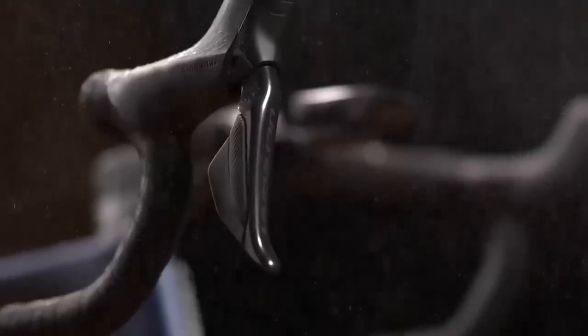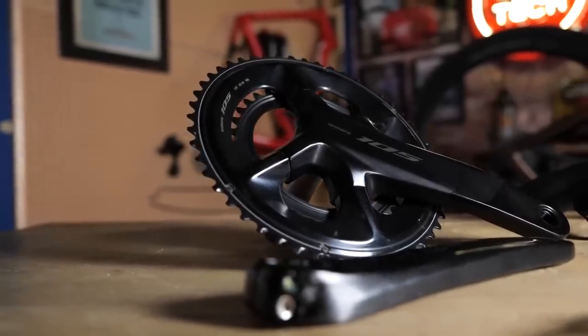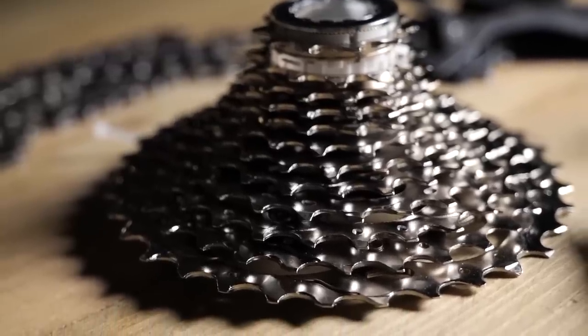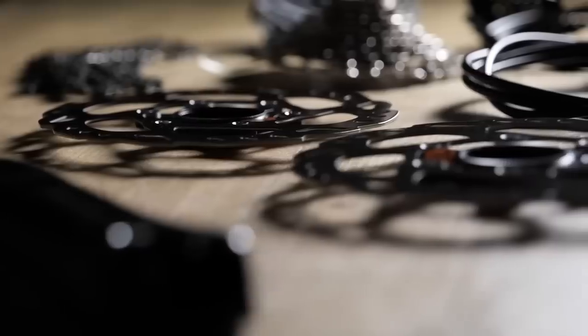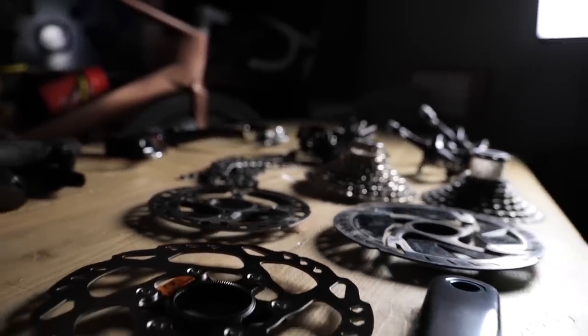There is no right or wrong answer. Having used lots of mechanical and lots of electronic groupsets, I think I would be slightly more prepared to go down a tier in order to get electronic shifting. I would say whatever you can get the best deal on — they're both excellent. Whatever you can do to save money and get the best price on either of those two, get that. And then you've got a bit more money to spend on another upgrade. In terms of usability, if you get an electronic groupset set up correctly, in theory you shouldn't have to make any adjustments — the cables don't wear out, you've just got to charge it up. With a mechanical groupset, the cable's eventually going to wear out and potentially break. But pros and cons of each, I guess. Nice dilemma to have — both are great options.